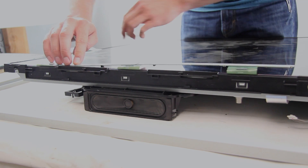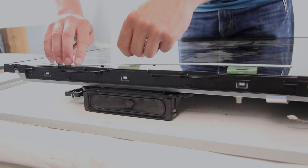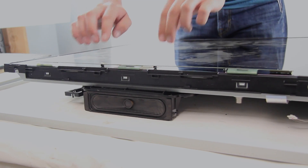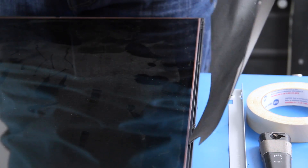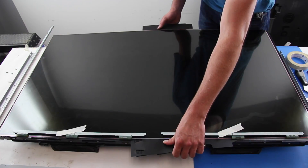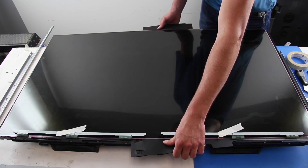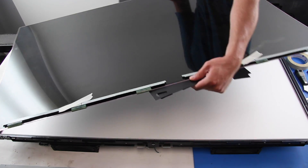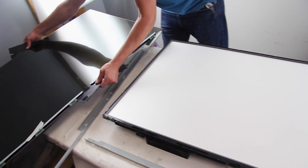The TV panel is fragile. Be sure to be very cautious with the panel to be sure it does not crack or break. Use two thin pieces of plastic or something similar to get underneath the panel. Be sure not to touch the underside of the panel with your hands. If you do not have thin plastic sheets, you can try using a few sheets of printer paper on each side of the panel to lift and remove it. Lift it away from the TV and set it aside on a non-abrasive surface.